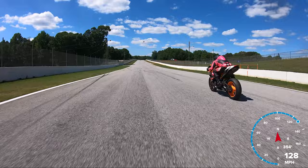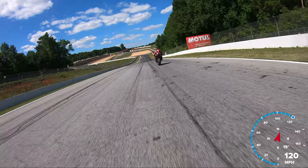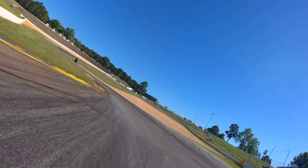They also gave me one in between, which is the 850. Putting in the 750 at Road Atlanta, where you do a lot of heavy braking in a couple of different spots, really helped out. The bike was slowing down much better. It got to the point with my braking markers that if I did not get to second gear into Turn 10A, I would actually run wide, because the rear of the bike was helping me turn — actually pulling the bike down and changing the geometry, letting me make the turn. So stuff like this really starts to matter when you get very specific in how you enter corners.